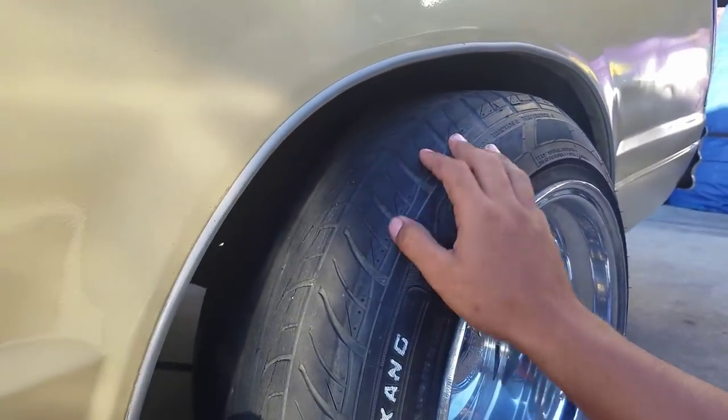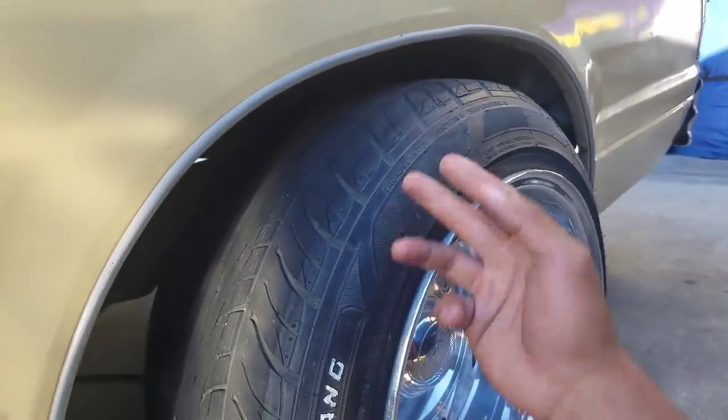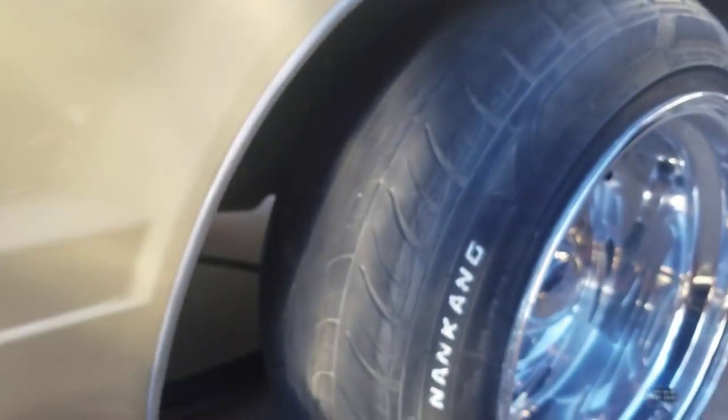Pretty much what I'm going to be doing in the rear is trimming the bump stops — not fully taking them off. Because when I took them off it was hitting up here. You guys can maybe see a little right there where the tire has been rubbing. That was a little too low and I don't want to hit and smack my rear quarter panels on my bed.